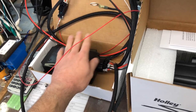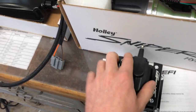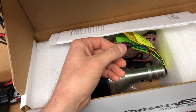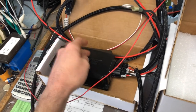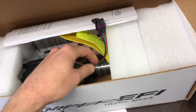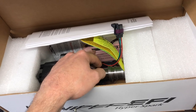It needs power, and I can bring the coil wire from the CD box over because power comes in here. You feed the coil directly off of this because it's capacitive discharge — that higher voltage feeds into the coil and gives you a real hot spark. The distributor has a pigtail with a little harness, and this has to go directly to the fuel injection unit because it tells the unit where you are. The fuel injection unit outputs to the white wire, which is the points input — basically it tells the CD box to fire.